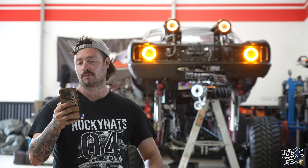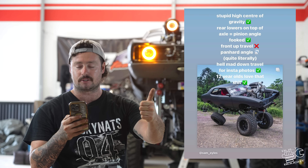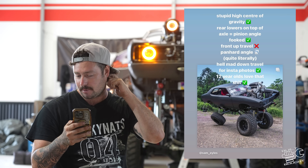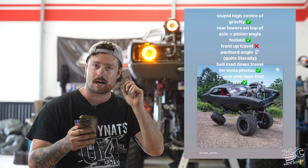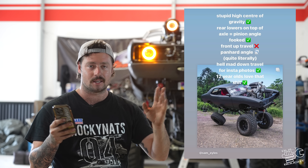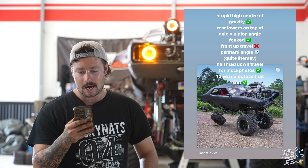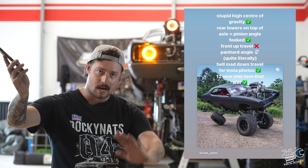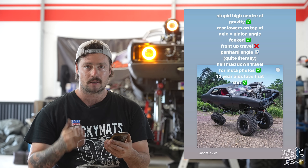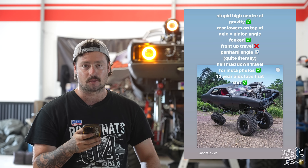Someone put up a lovely story with ticks and crosses. Apparently it gets an A for very stupid high center of gravity. Yeah, got it high. People are so stuck in the ways of building a car for the street or for off-roading. When you're trying to do something different, their mind can't comprehend. But yes, it's got a high center of gravity — I didn't build it to be stable. Lowers on top of the axle — same deal. We had our lower arms below and they were on a stupid angle, so I raised them up. It kind of made sense, looked right. No, it's not the best for anti-squat and diff roll — but that's not what I built it for.